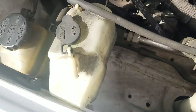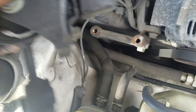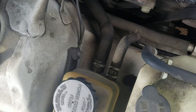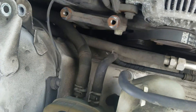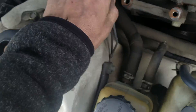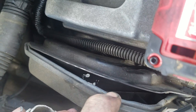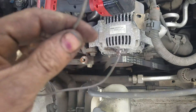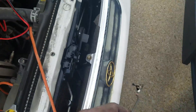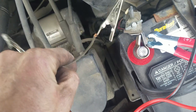How did I find out within five minutes that it was in fact a timing belt? 14 millimeter, 14 millimeter, 14 millimeter — boom boom boom — take out this cover. Most all the Toyota Camrys are like this, they're pretty simple. 10 millimeter right here, take that out with the ratchet, peel this back. Put a spot of paint on the timing belt — you can see a little paint splatter in there, looks like bird poop. I applied it with my finger.